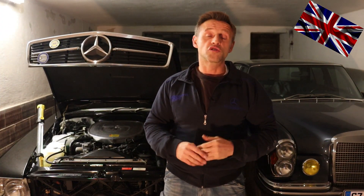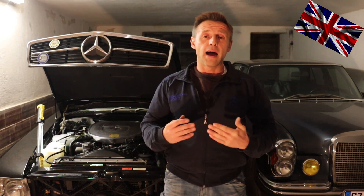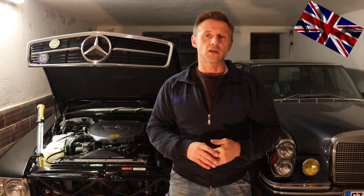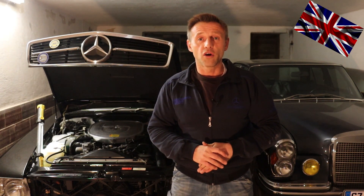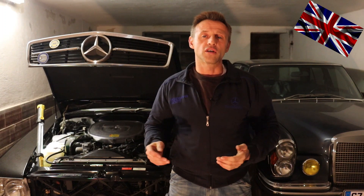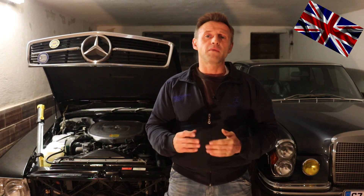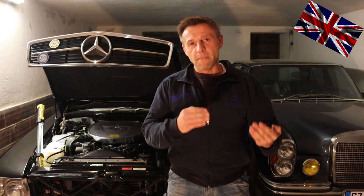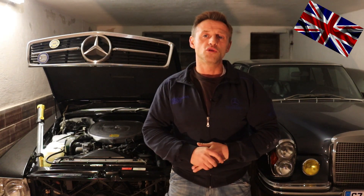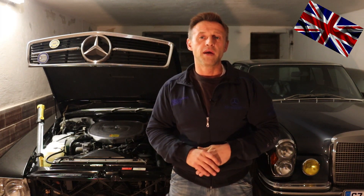To check the feeler named B13 in the diagram, as shown here on a 560 SL with an engine M117 - the feeler is close to the radiator. With the M103 engine the feeler is mounted closer to the firewall, next to the fuel flow divider. We could go on with further tests, such as connecting a 68 ohm resistance between the plug at the radiator and ground - the needle should swing to 80 degrees Celsius or 180 degrees Fahrenheit. When repeating this with a 37 ohm resistance, the needle should show 100 degrees Celsius or 210 degrees Fahrenheit.